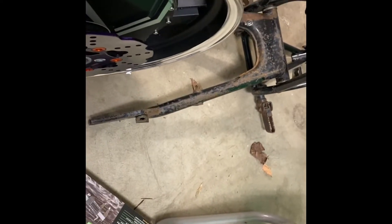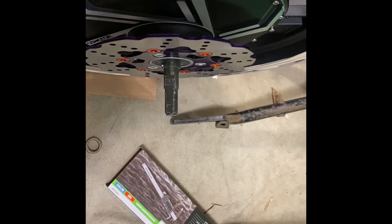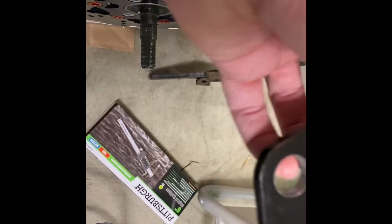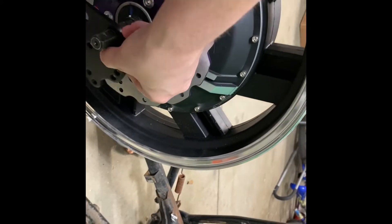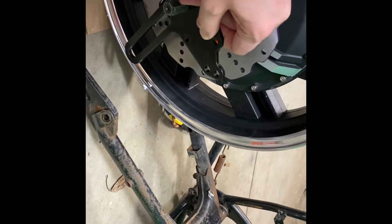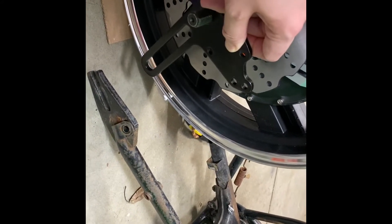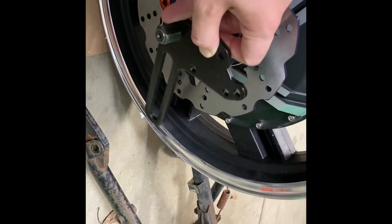This bike was originally set up for drum brakes and we're putting a new hub motor on and wanted to put a disc on here with a caliper. From what I've seen other people do, this bigger hole here where my finger is sticking through is supposed to go through the axle and come out so that front leg kind of faces towards the front of the bike. You have to have some kind of brace on there to keep it from rotating, but it really won't fit to put it like that.